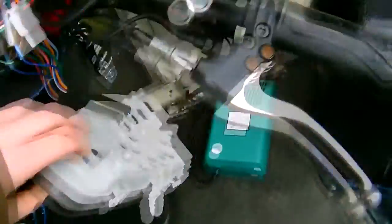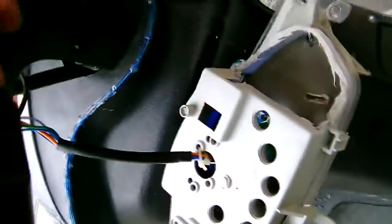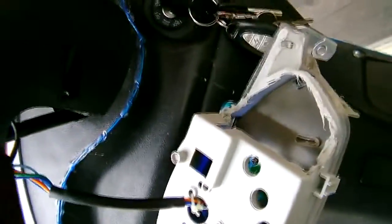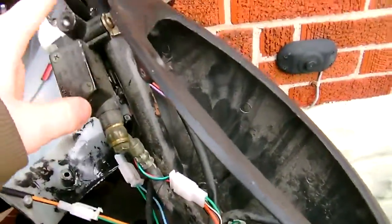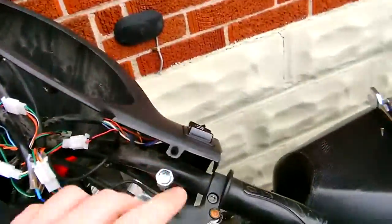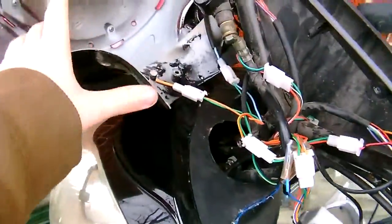Got it hooked up and on. Took apart the front. To take apart the front of one of these — most of them, Geos and stuff like that — it's literally four bolts, two on each side, a major bolt in the back, and a major bolt on the front. And then, just make sure before you do any of that, take the mirrors off too, and then this whole front piece will come out.